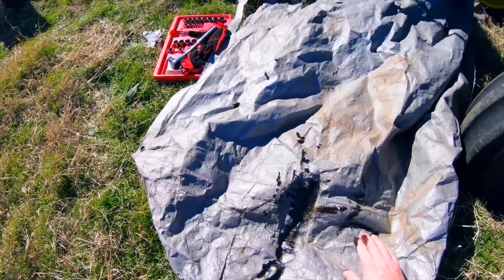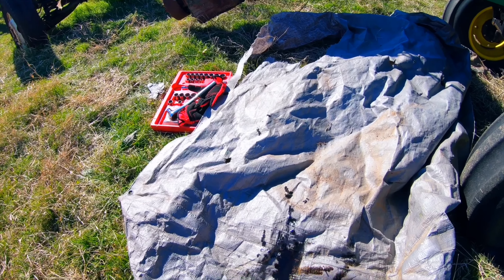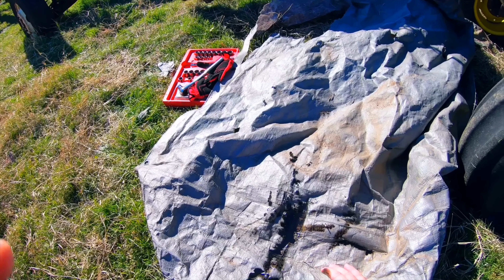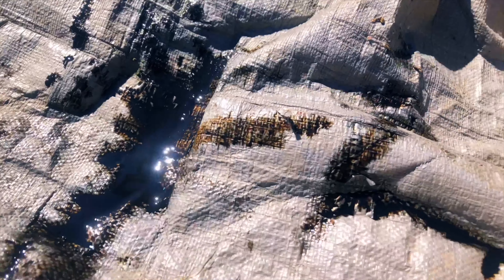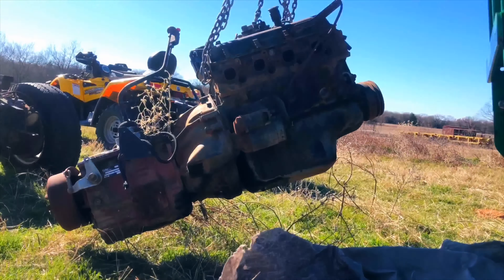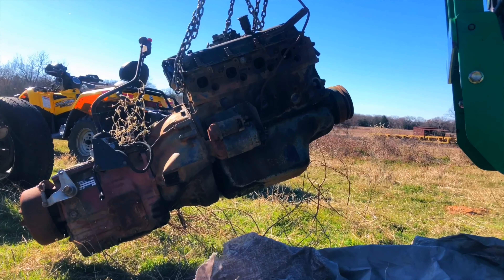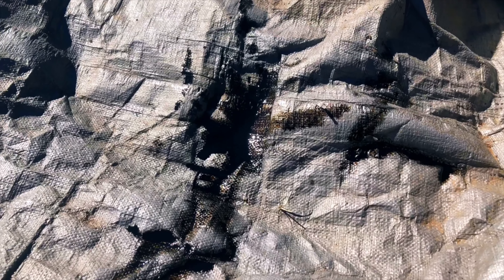We're gonna pull out this tarp and look at the oil in the sunlight. To me that is clean oil - there's just a little bit of a slight discoloration right in here, it might be hard to see. Just ever so slightly the discoloration - we're talking ever so slightly. It looks like pretty clean oil, so I couldn't see much moisture or anything. The holes I could see, the carb was dry, some of the other holes looked dry, so hopefully we don't have any issues with the motor and it can be rebuilt.